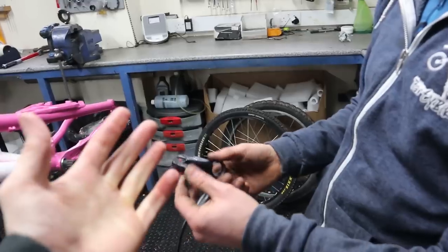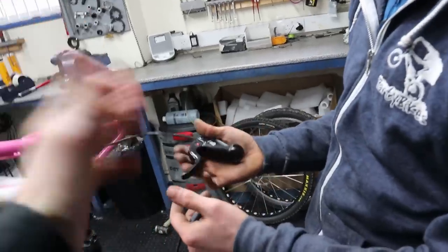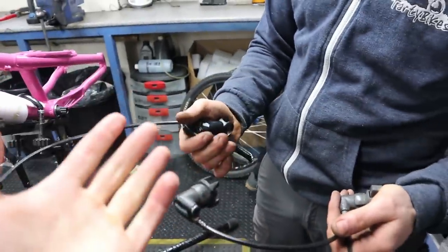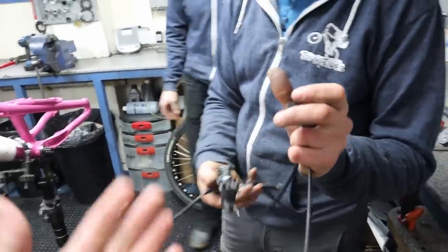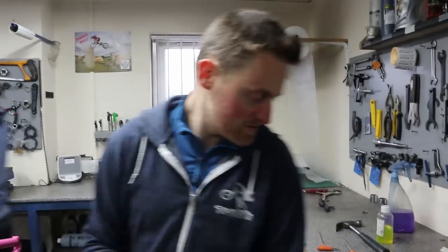So that's the first thing we're going to do — cut away to get rid of a stress riser essentially. The second thing to make my hands have a much easier life is to change the fluid in this. Magura's hydraulic brakes are full of mineral fluid, which is quite a viscous fluid, so the speed at which the piston returns is fairly slow, meaning it's more effort with your finger.